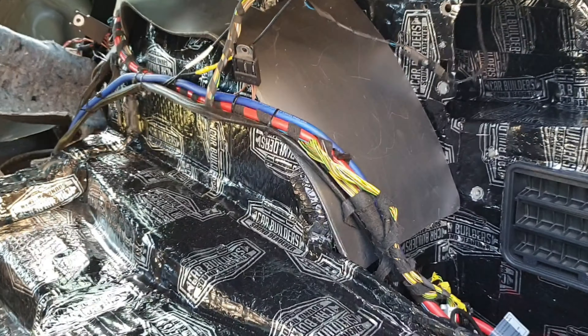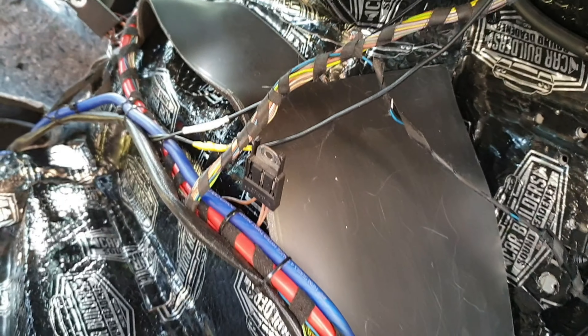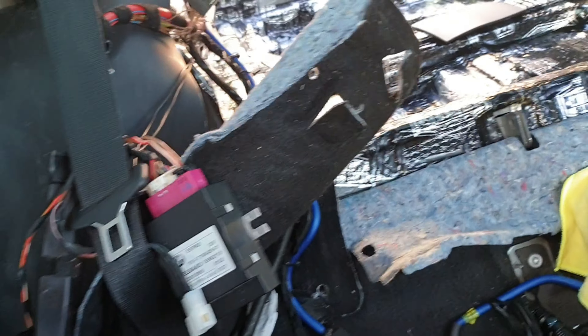Just test fitting the mass-loaded vinyl across the top of the wheel well. It's going to take a few goes to trim it up and get it absolutely right. That end seems to fit okay into the battery area and covers the top of the wheel well. Going around the front, we've tucked it up underneath all that wiring — it covers it all in one big piece and runs down into there. Now I need to work out what holes to cut out of it, but it seems to fit and I think that's going to work.